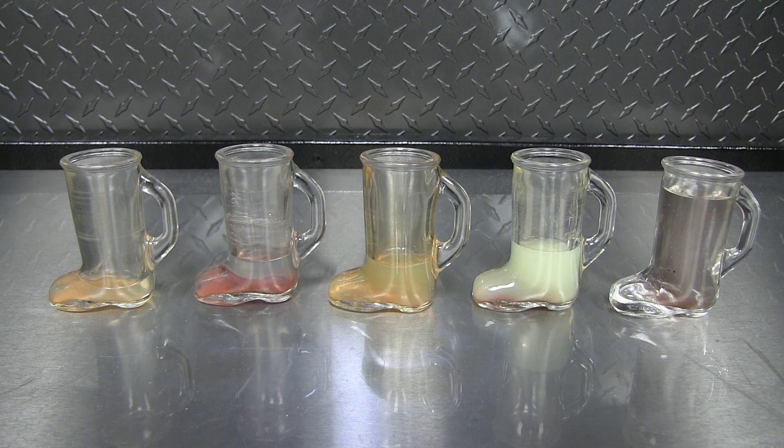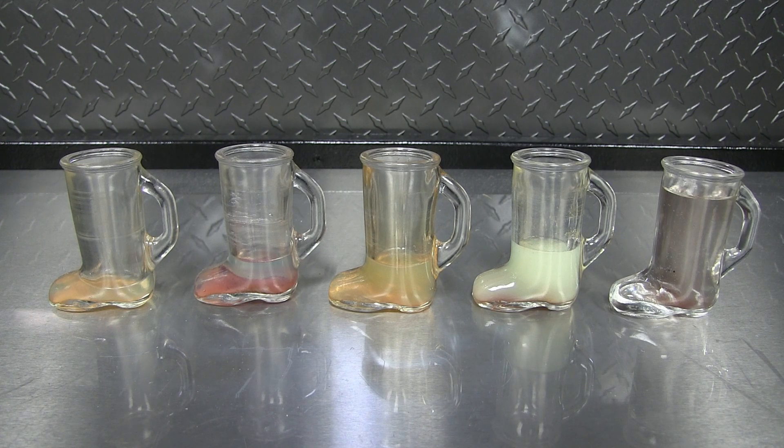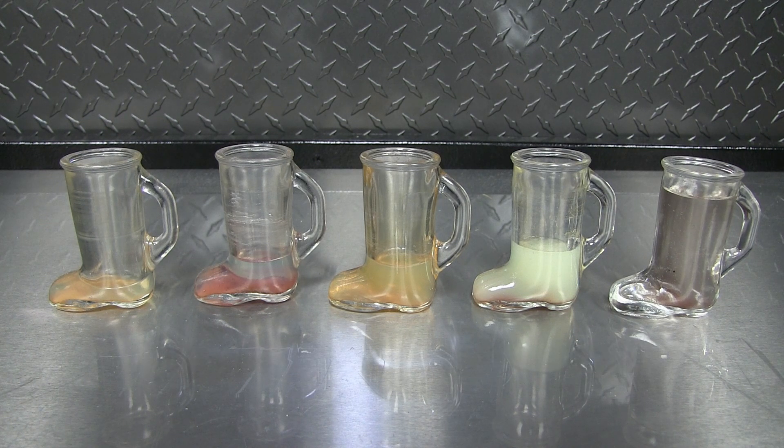I've seen a lot of videos where people do this kind of flush and it looks like in three or four steps they go from red Dex Cool to light brown to light green coolant. And in the comments there's usually people asking, hey, I'm on the 10th or 12th flush and it's still coming out brown. Well, my advice is if you can see there's a lot of gunk in your radiator, you might have to go about it with different methods — like a pressure washer, forcing water and air through your radiator, pulling off your coolant hoses — a little more extensive, because this did take 12 times. It only takes about five minutes for me to drain and refill, and the water is cheap, but still — we're done. We've got it switched over to the green and I'm just going to move forward. Hope you enjoyed the video, hope you learned something, thanks for watching.